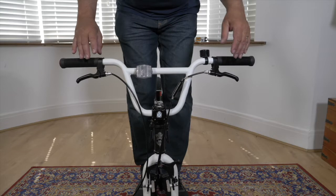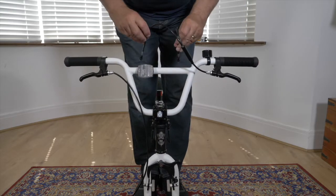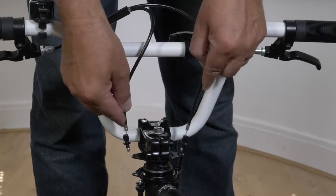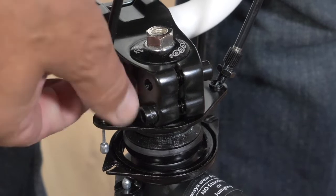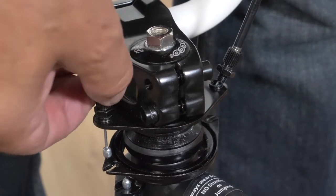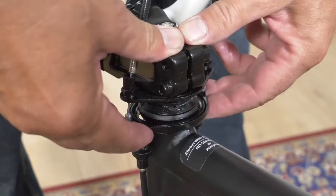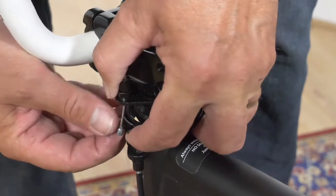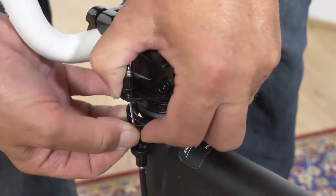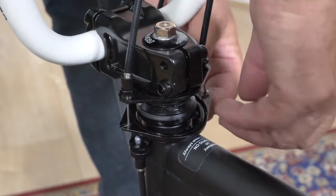Attaching the rear brakes: the cables for the rear brake on this BMX attach to the 360-degree gyro. Feed the brake cables over the handlebars. Feed both cables into the gyro top plate and screw the nuts into the gyro top plate so the cables are attached. The bottom plate on the gyro is spring-loaded. Lift the bottom gyro plate up and slot the brake cable into the gyro brake housing. Then repeat the same process for the other side.